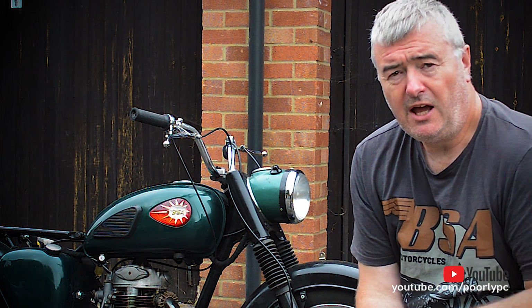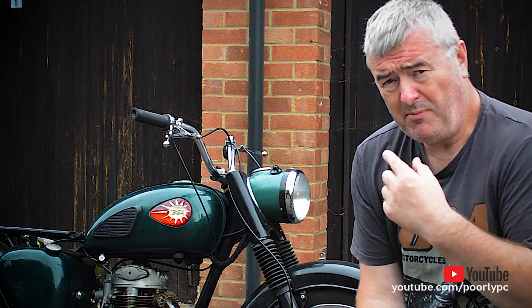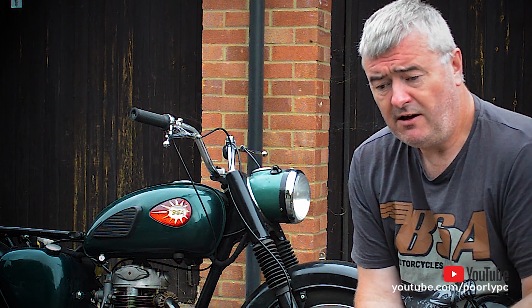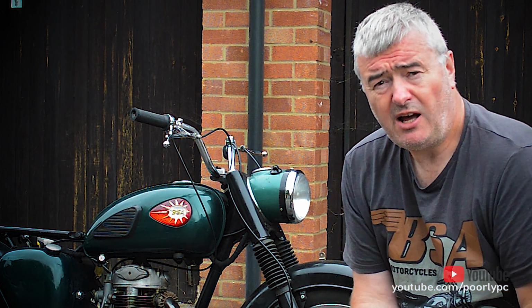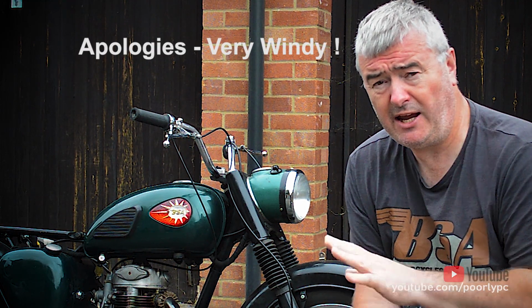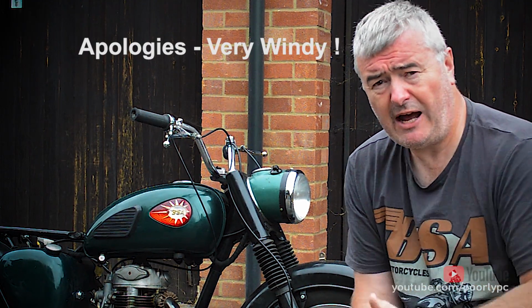Good afternoon. For those that have been following my progress, I've rebuilt my C15 gearbox, but I've hit a snag. I'm conscious that one of the female castings that take the inner cover case was damaged, and I've always been conscious of this. On rebuilding the gearbox, the cam plate and the gears select perfectly, but I've noticed that when I start the engine I'm getting oil pushed out of that aperture.